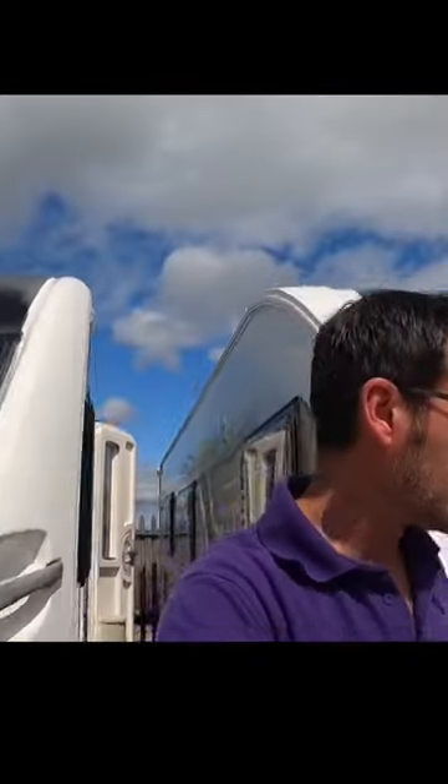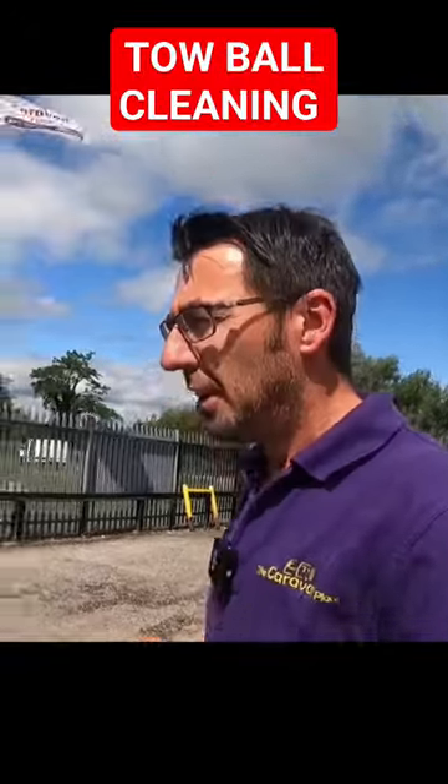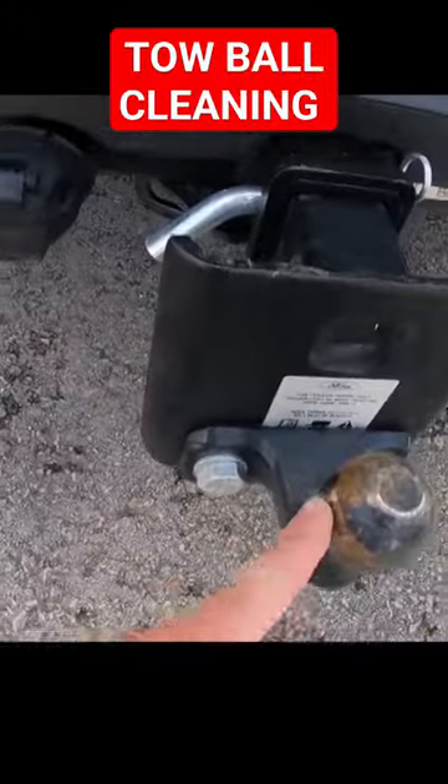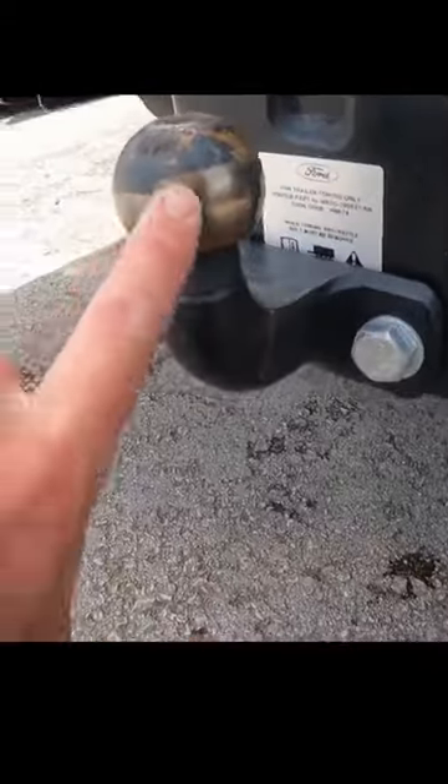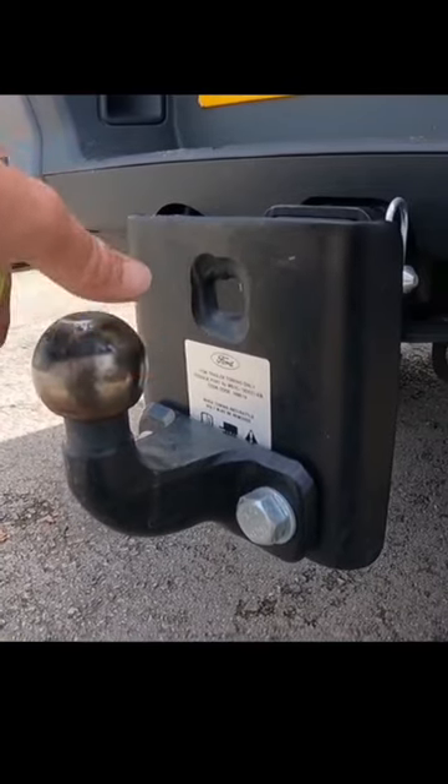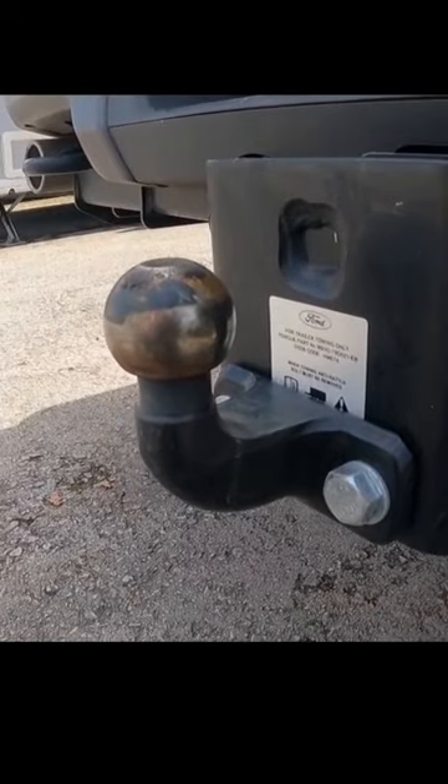Someone said their hitch was making noise on the back of the car. Number one is your actual tow ball — what you really want to do is get some emery cloth and give that area a good clean up. Then use a little bit of white spirits, alcohol cleaner, or contact cleaner to make sure your tow ball is nice and clean.